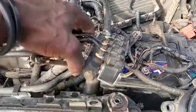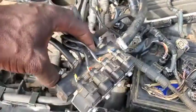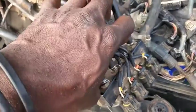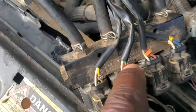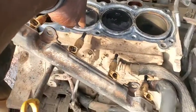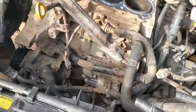The first component is the injector. This is the injector for a four-cylinder engine and it doesn't have a different wire for the ignition coil. Most of them are going to come with injector one, injector two, injector three, injector four — where injector one goes here, injector two goes here, injector three goes here, and injector four goes here on the intake manifold.